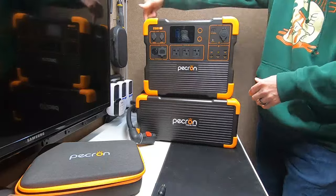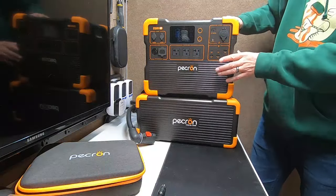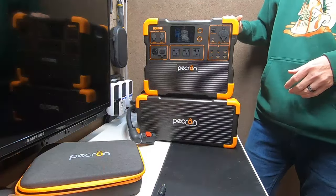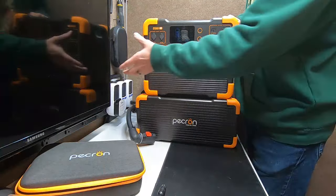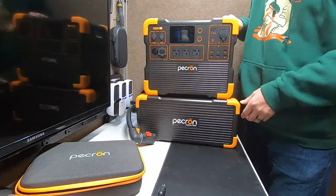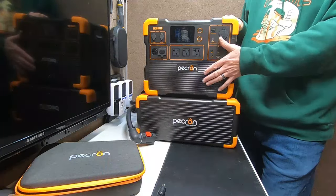And these will be hanging out that way, maybe so I can put them next to each other. But you don't want to put systems next to each other and run them, guys, because the hot air will blow into each other, and they're just going to be breathing on each other all day. Remember, the hot air from one system will be sucked into the next system. Which means what happens to the second system? It's going to get hot. It doesn't properly cool down because it's breathing in hot air.